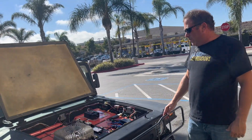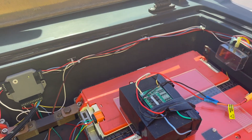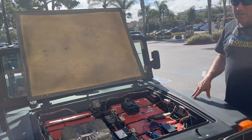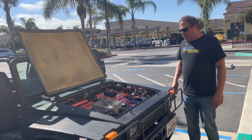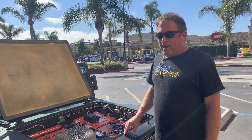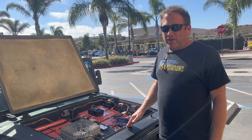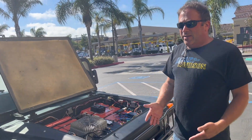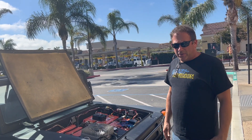You do have lights. This is my 12-volt battery — you still need a regular 12-volt battery. I just didn't want any lead-acid in here at all. So these are three modules from a Ford C-Max, with a BMS on here that manages them — that gives me the 12 volts that normal car stuff needs. The charger needs that for its signaling, the controller needs 12 volts too, and there's a DC-to-DC converter that acts like the alternator does in a regular car, keeping the 12-volt battery topped up while you're driving. I changed all the bulbs I could to LED so they don't burn out, take the least amount of power, and look better.